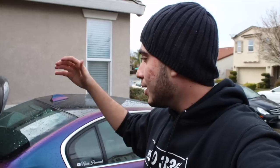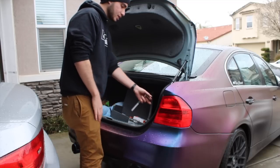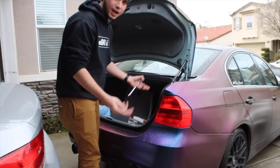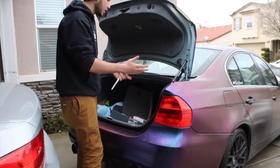I'm installing the paddle-shifting steering wheel into this car. I'm gonna show you guys how to remove it and make it as easy as possible — it doesn't take much time, about 20 minutes. The hardest part is getting out the airbag, and after that it's all plug and play. If you guys haven't seen the last video, you do need the retrofit kit from Burger Tuning — I'll have their link in the description. This video is just installing the steering wheel. Make sure you disconnect the negative terminal so the airbag doesn't blow or anything weird happens — you won't get any warning lights.